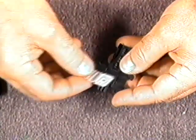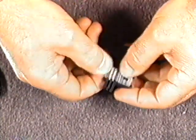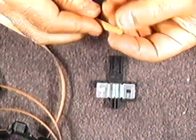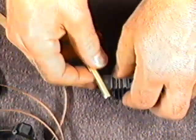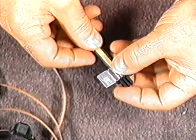Place connector in alignment tool, then peel back adhesive backing and position Californeon. Caution: do not insert Californeon into connector more than 3/16 of an inch. Be sure groove on back of the Californeon strip lies directly over the space between the metal piercing strips. Check this carefully, then squeeze tightly with your thumb and fingers.